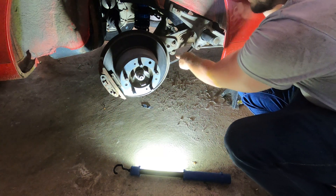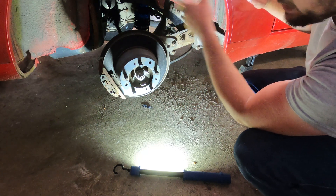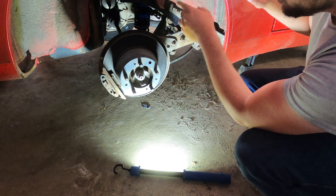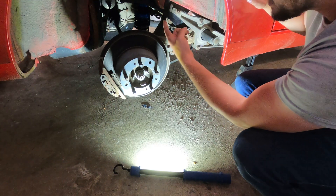The right way involves pulling the rear sway bar out first. If you have one — some models do, some models don't. That's a 17mm bolt down here. Then you need to pull both axles. You don't have to completely drop them. On the transmission side, use an M8 triple square bit and pull all of the bolts out and hang it. There are a bunch of spots up above you can hang it from. I used bungee cords — super easy.